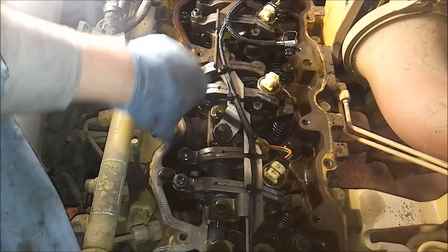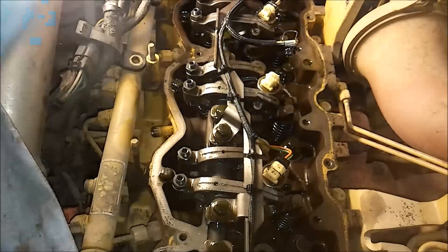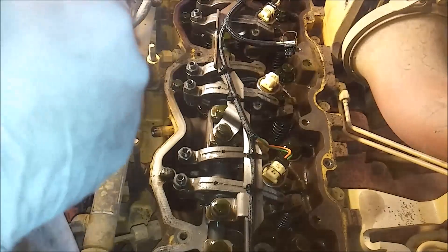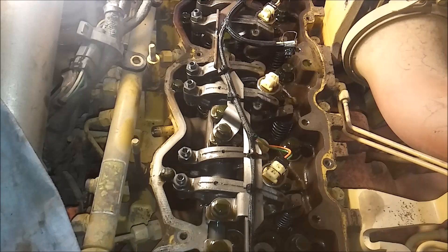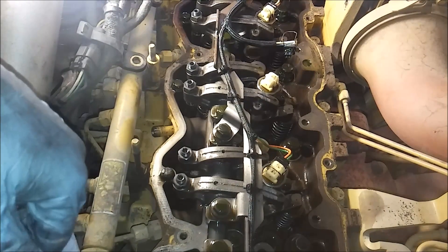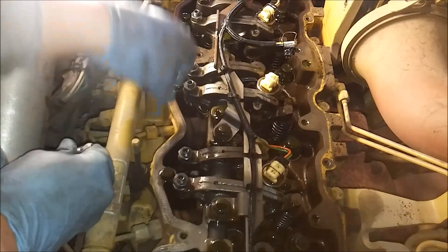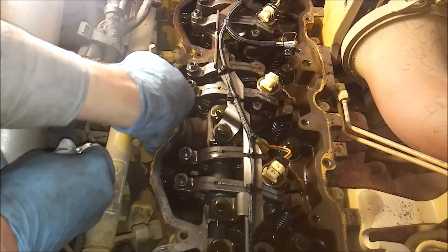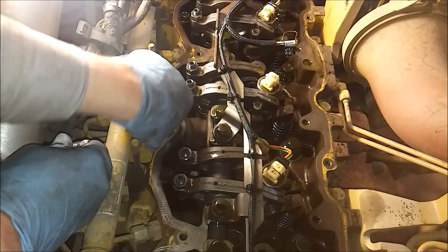So you take the nut off - you're going to reuse the nut, so put that aside and clean it. Next is to pull the quill tube out. Now the only thing that holds it in there after the nut's out is a single O-ring, but it's still kind of a pain to pull out because that O-ring can be hard to get and there's really nothing to grab onto with that quill tube. You don't want to damage it because on the Cats you can reuse it as long as it's not damaged.